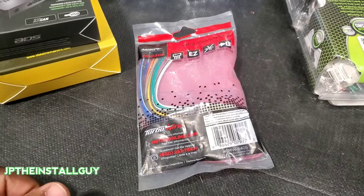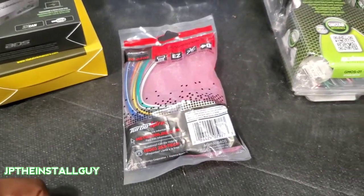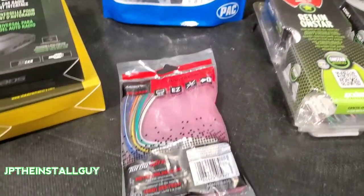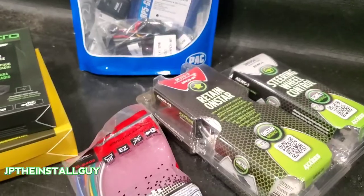If everything lines up and you don't mind doing the work, you can still get the basic harness — just know that the accessory wire won't be provided by a module. All you gotta do is use a fuse tap or something like that. I actually just recently made a video about that — link will be in the description. And if you're bypassing your factory amp and don't need any type of integration, go ahead and get this harness just to get your power.